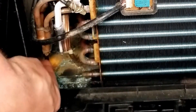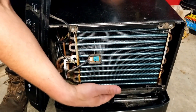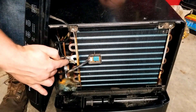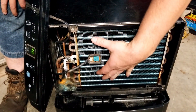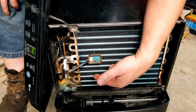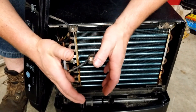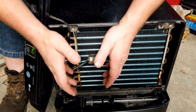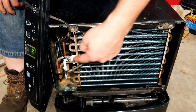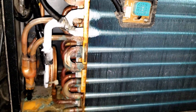Mongo's already been in here before. This is the temperature sensor — the frost sensor. Normally that sensor is way down at the exit of the heat exchanger, so it wouldn't even sense that it's cold until the entire thing is ice. That was the first main problem this one had — the whole thing would turn into a block of ice because it wouldn't shut the machine off until that spot got icy. So Mongo moved the sensor to the intake. That way there's less chance of the machine building that block of ice and also less chance for the machine to leak freon. What happens is the ice builds up, separates all the little fins, pushes them apart a little bit, and that causes freon to leak out. Those pieces come back together and seal, and after thousands of cycles all your freon is gone. Moving the sensor to the front keeps that from happening and keeps the machine lasting a long time. It's the worst possible location — way to go, LG, on making a terrible dehumidifier.